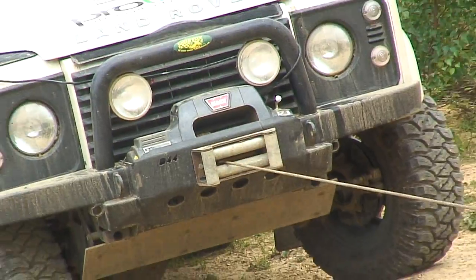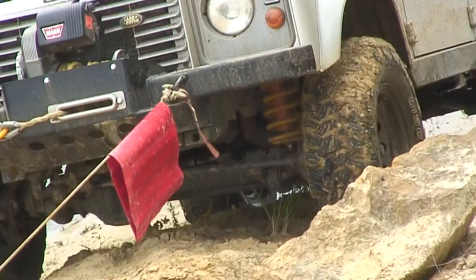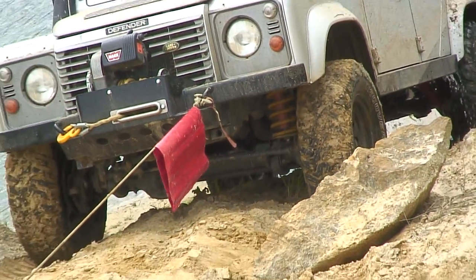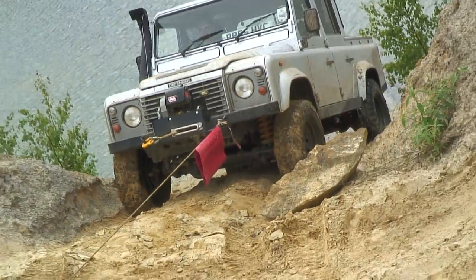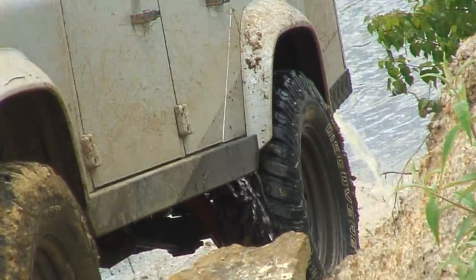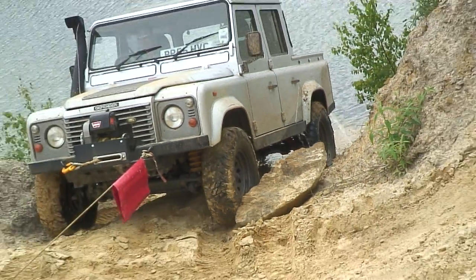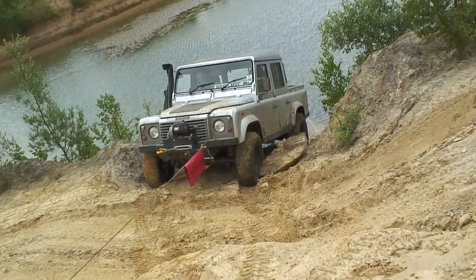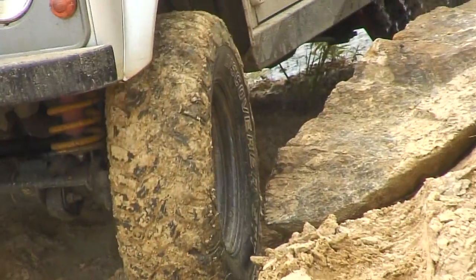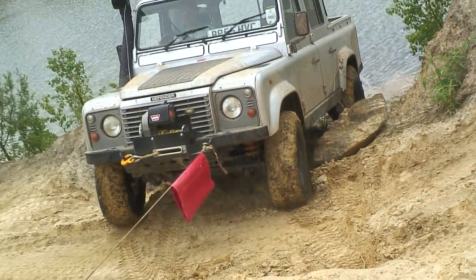As you can see, I'm sitting in the vehicle, I've got the engine running, I've got my foot on the foot brake, and I've actually got my wheels turned on full left-hand lock. All that helps increase the rolling resistance, because obviously I'm facing downhill, quite loose ground. Ed's coming out of quite a muddy, boggy hole. He weighs a lot more than me. The resistance coupled up with the weight of that vehicle is probably double to me.